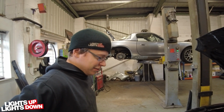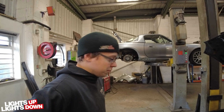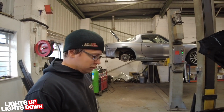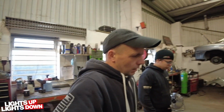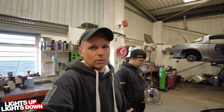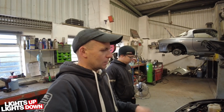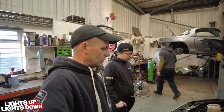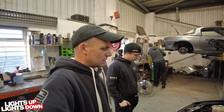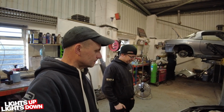And do I still need to look at the charging issue, or have you looked into it yet? It just is the charging issue. Looking at this, it's obviously got an aftermarket ECU in, so sometimes if the settings aren't completely honed in right, he gets his ignition light come on, which is normally a direct sign of over voltage or it not charging. So I'll just have a look at that, change a few settings, and go from there. Really, I don't think it's going to be anything particularly hard.